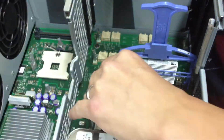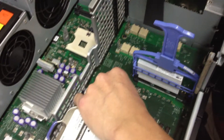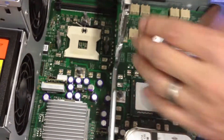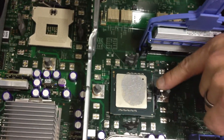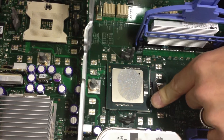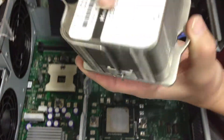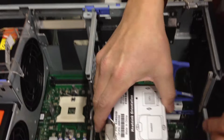You want to not force it — it will nestle in there. Once you've got the pins aligned in the right spot it should nestle in, and it'll actually sink down a little as it nestles in. Then gently move it back and you'll see the CPU shift back. Then reverse the procedure. The heat sink will be right side up if you're in the front. Remember to put the hole in the posts.